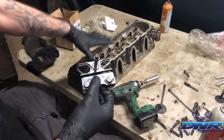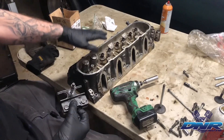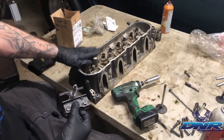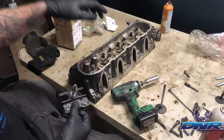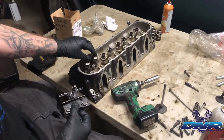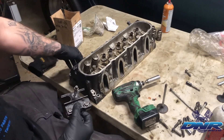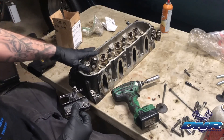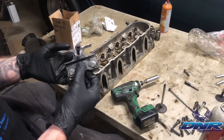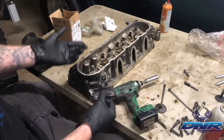The rockers are already removed and the head is removed. A lot of folks when doing the valve swap are also doing head gaskets or some other stuff. It is much, much easier to do this with the heads off than with the heads on the motor. It can be done with the head installed on the motor, but the issue is you have to use compressed air in the spark plug hole to hold the valves up so they don't fall in — it can become a real pain. That's why I always recommend doing it with the head off if you can.